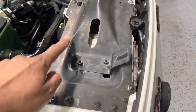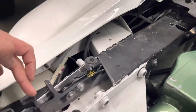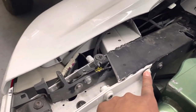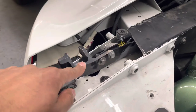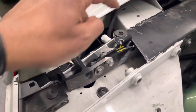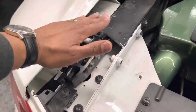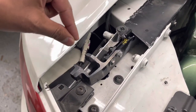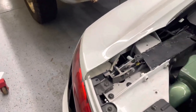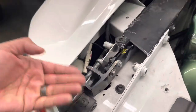You'll need to order a couple parts — you'll need this bracket for sure, and then on this side this big bracket right here goes from here and it's about that long. I've got it all loose right now, but you'll need that bracket and also this bracket right here. This bracket holds the base panel — this is where your adjustment is for fitment height. This one here is where the wing has a stud and it bolts in. There's one bolt that comes through and you tighten it in, and that's what holds the wing from actually popping out.